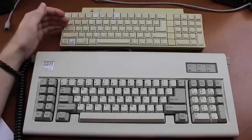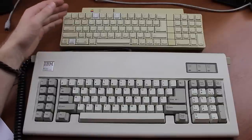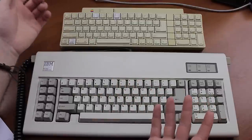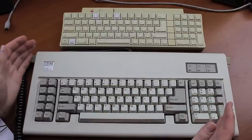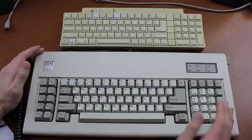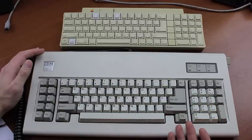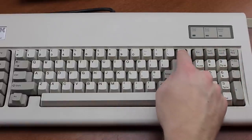This layout is a bit antiquated — not weird, considering this keyboard is from 1990 — and some of the younger ones among you may be wondering what's up with that. But basically it's a variation of the AT layout used on old IBM keyboards like the Model F, a layout that was quite common before the invention of the modern 101 or 104-key layout, characterized by a big enter key and a small backspace.